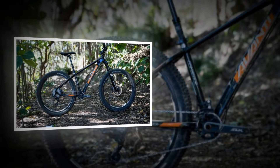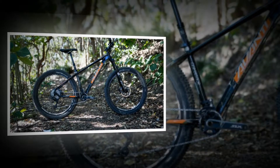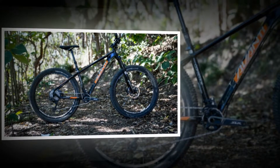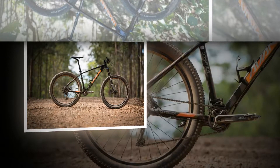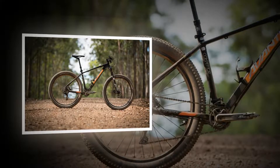The Competitor 2 is the brand's highest spec 27.5-plus hardtail with an SLX-XD drivetrain, 120mm RockShox Reba fork, boost hub spacing, and dropper post, while still hitting a relatively low price point. The alloy frame is heavily hydroformed with hardly a round tube in sight.